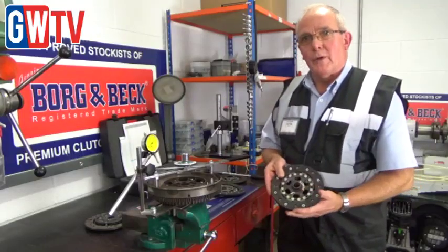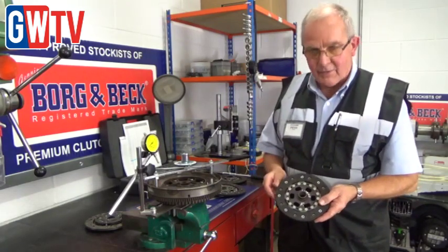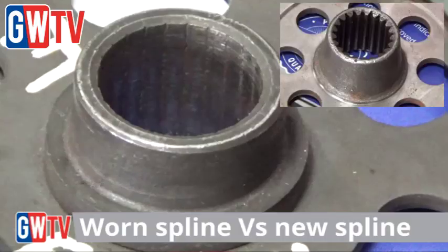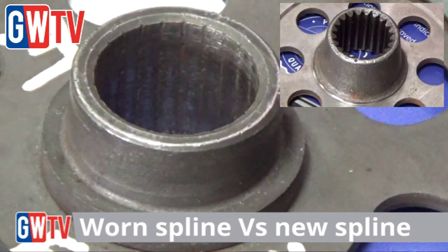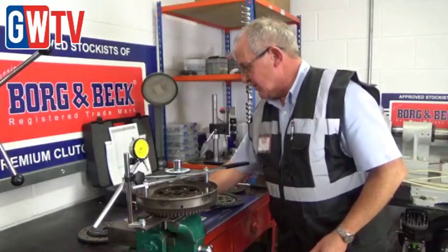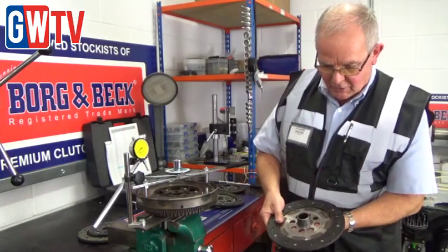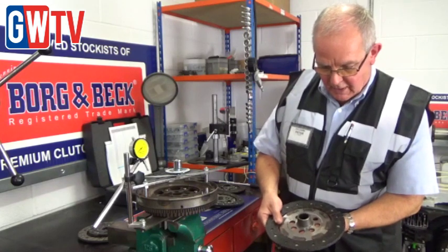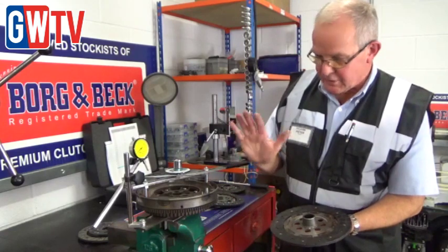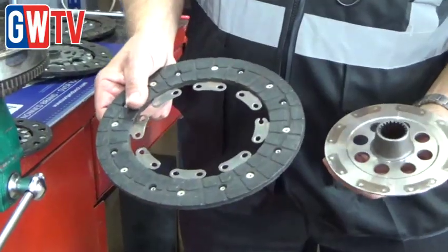When you've got a flywheel in a worn condition, if you put a new clutch on it and the springs in the flywheel have worn or broken down, the hammering effect will physically take out the spline on the driven plate. The other condition that can happen due to excessive end float on the moving face is that the facing segments and the disc adapter into the hub can shuffle because of the deflections, until it takes the rivet heads off and finally fails.